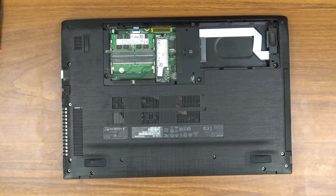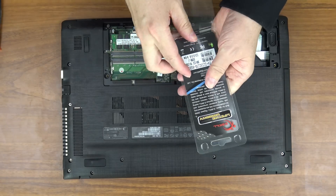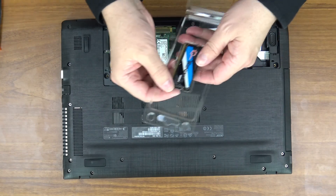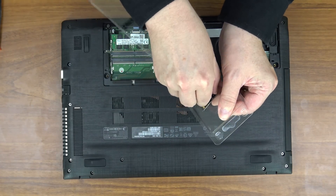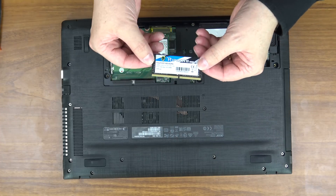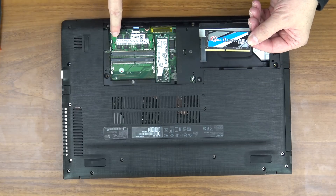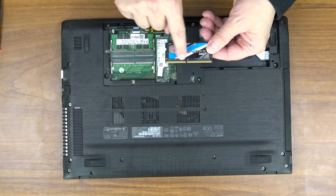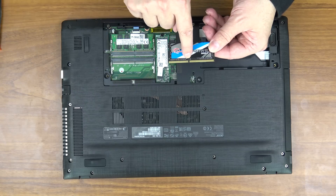So all we're going to do here is open up my memory carefully. Sometimes these memory modules are just held in by plastic — you don't want to bend it too much, but you've got to flex the plastic to get it out. Now these will look different depending on which one you buy. This has nice pretty stickers on it because G-Skill puts — it's a retail kit designed for end consumers. This one doesn't have a pretty sticker, but it's the exact same thing. If you look along the bottom of the memory module, it will look the same no matter what you get. There is a notch — not midway, not two-thirds over, but about that far over.